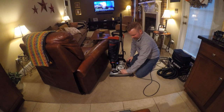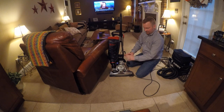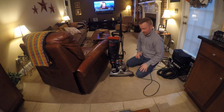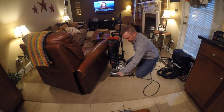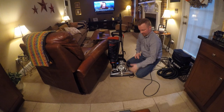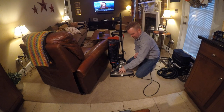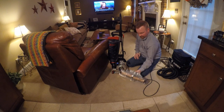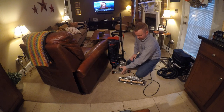I do want to go over the belt drive here. If you're going to clean carpet, most of the time you'll leave this machine just like this. If you're going to convert to any kind of bare floor or change attachments, it's got directions here — all you do is flip this around. All this does is it releases the belt off of the drive shaft in here. Turn it off. The power head comes off. You've got your brush roll here. Your hose.